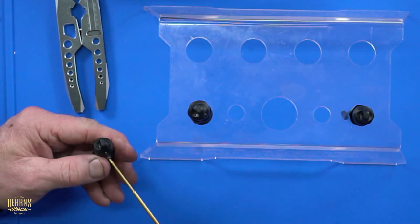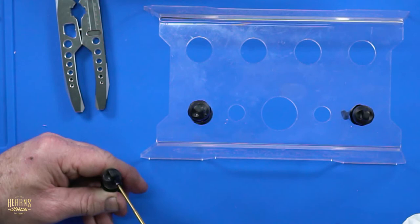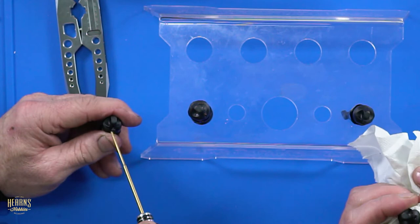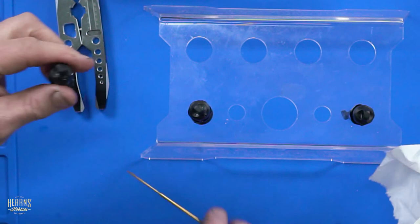So what you're saying is we put the body on and put the screw in a little bit. These screws that they supply are really tight tolerance on the 1.5. I think they must do it so that when you wear them out, they fit properly. I have noticed that before. The tooling is extremely close, you can't actually get the driver in unless you're really square with it. The other thing I like to do is always make sure that hole is the highest point on the shock.